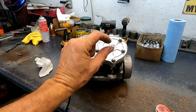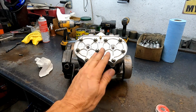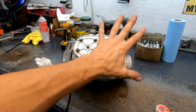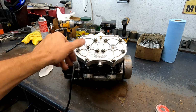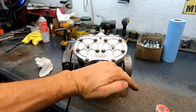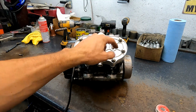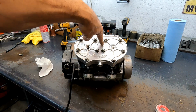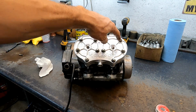Now, drag racing will get the squish down real thin and tight. It'll make a lot of good power, but it heat soaks real quick, and the horsepower starts bleeding off as the combustion area gets hotter. You can keep the motor at a certain temperature in the water through the coolant, and you'll go, oh, it's fine, it's 180 degrees. But this combustion chamber will run hotter, and the horsepower will actually diminish. You see it on the dynos all the time. So don't knock a thicker squish, especially on pump gas. This 91 in California is crap. I'm very comfortable with 60 to 70 thousandths squish with 130 to 140 PSI static.